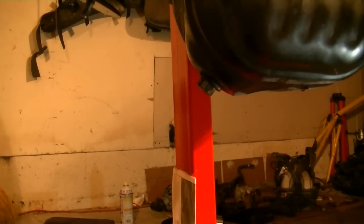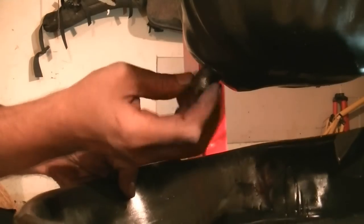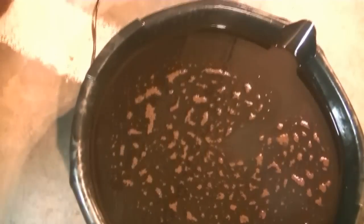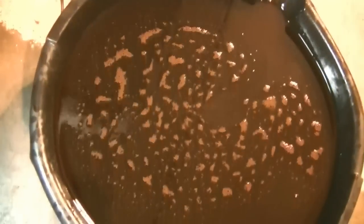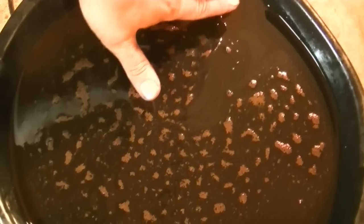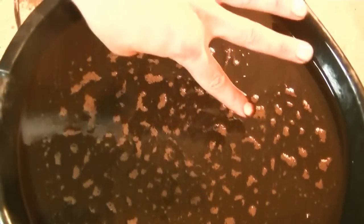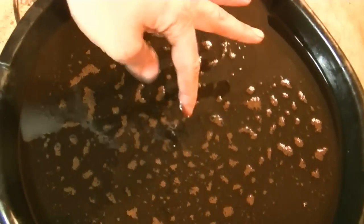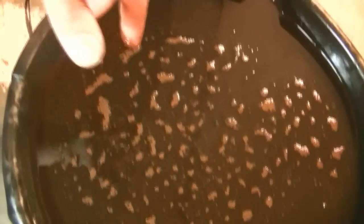Next it's time to remove the oil pump. Before we do that, I'm going to drain the oil out of this and remove the oil filter. Here's a look at the oil I just got out of the engine — there's no metal shavings for an engine that's got a rod knock, but they could have always replaced the oil after they got the knock. These are all air bubbles you see here and the oil looks kind of old. No signs of metal shavings in this oil.